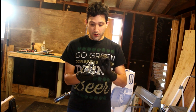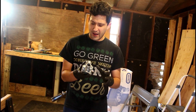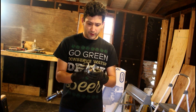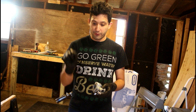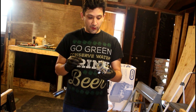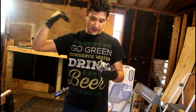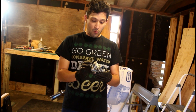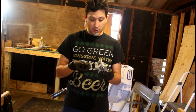So we were using a 32.5 and that wasn't really going anywhere. What we're going to do is go back to the start — throw in a number 20 pilot jet and start from there, going up gradually in jet size to see where we land on a good fit.